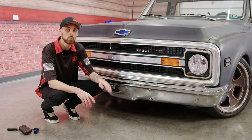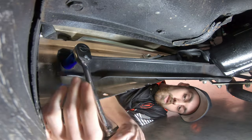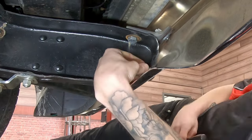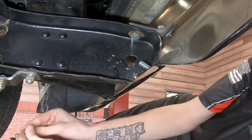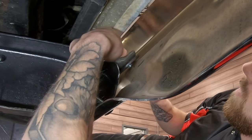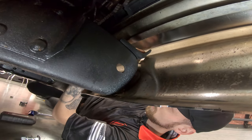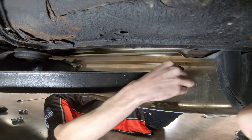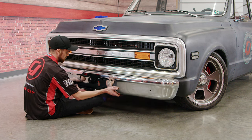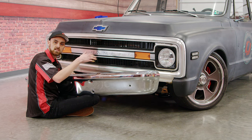The first step of our process here is going to be to remove the front bumper. We're going to remove all of these bolts, and then we'll pop off the front bumper. With all the hardware removed, we can go ahead and remove the front bumper. Sometimes when removing these, it can be a little tricky because the bolts will actually get stuck in the mounting holes, so you can use a rubber mallet to tap the front bumper off.